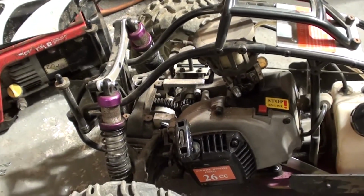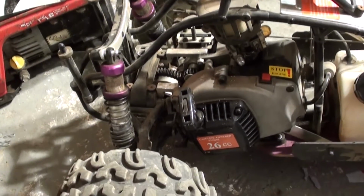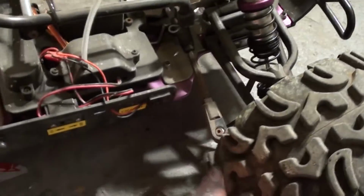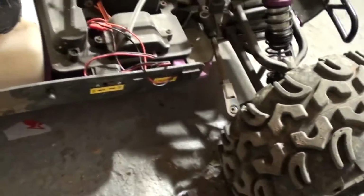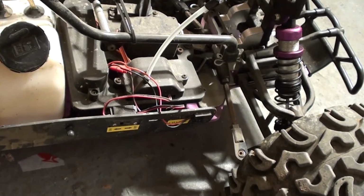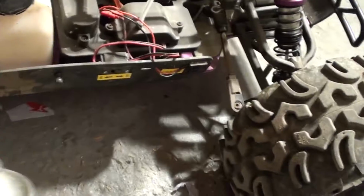I know a lot of people aren't going to take any notice of me, but it was paining me watching these people making these videos, and you can see there's a lot of play in their joints and bits and bobs, and they're driving through big puddles. And another thing as well, if you're going to go out in the wet, in the rain or in any mud, oil the joints and oil everything before you go out.